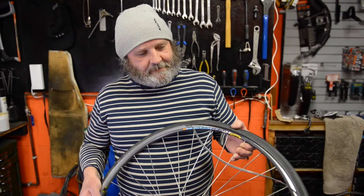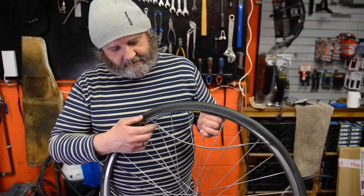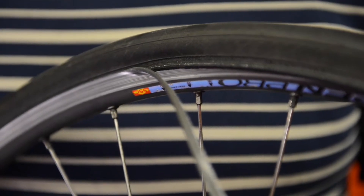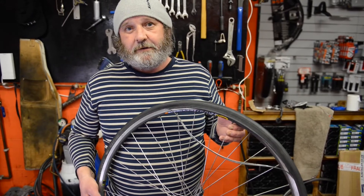You can see what a mess has been made here. Basically the rim is so thin that the pressure of the tire has just made it collapse, fold over, and blow out. You can imagine what would happen if that happened at 30 or 40 miles an hour — you'd just go over the handlebars, this would be wrapped around the carbon forks, and you'd probably go to hospital.